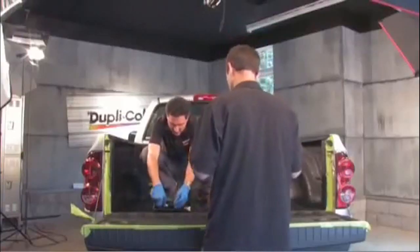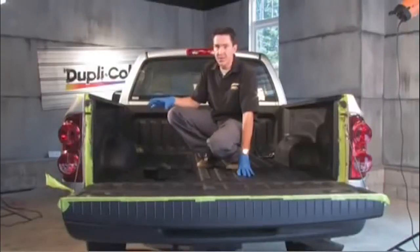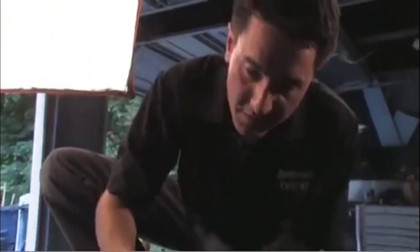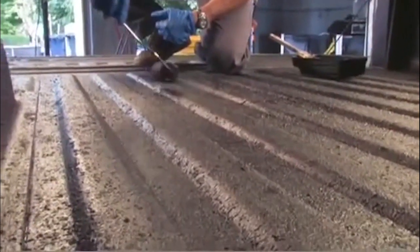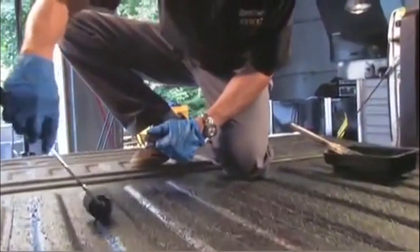The first coat is complete and dry — we let it dry for about an hour. I'm now able to get back in here and check out how I'm going to start laying down the second coat. We do recommend two coats for full coverage and for that film thickness you're looking for, for all the durability that you need. You can go more than two coats if you want to, but two coats is the minimum we recommend. I'm almost through putting down a second coat of BedArmor. This is a textured coating, so when you lay it down, make sure you lay it down as evenly as possible. The roller does a good job of that, and the brush that comes in the kit will help you get in every nook and cranny and all the little cracks and crevices that a truck bed has.